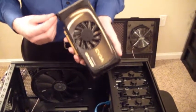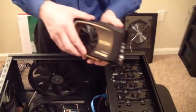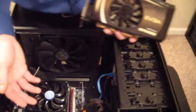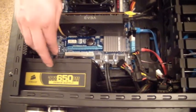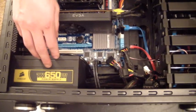It is important that this card not be a 560 Ti, or a 550, or a different card entirely like one of the ATI cards — they must be exactly GTX 560s. Now this one is factory overclocked, different than this one, and that doesn't matter. They just have to have the exact same GPU. 560 Ti: not okay. 560: okay. We need to also make sure the power supply can handle it — this one barely might handle it. We're hoping for the best.